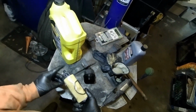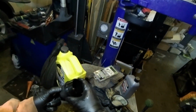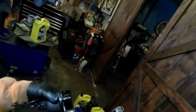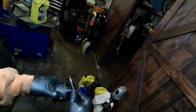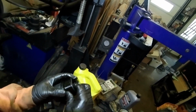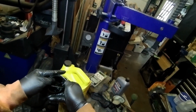And since it has a new O-ring, we're going to put the new O-ring on. And you can see right around the top here is that little O-ring. So we're going to get a little hook that we are going to grab, and then we use this little tool here. Just basically kind of ride it around, and you'll be able to pull that old O-ring off pretty easy. Right in the garbage. And then with your new O-ring, you want to put it back on. And what you're doing is you're kind of rolling it down the cover. Easier said than done.